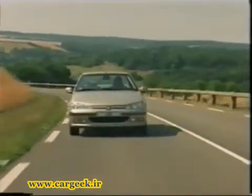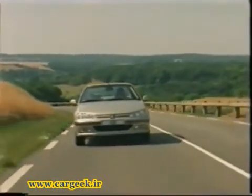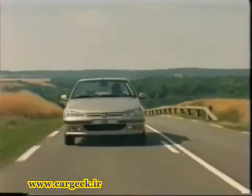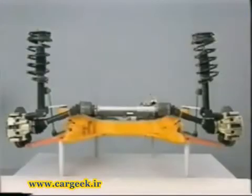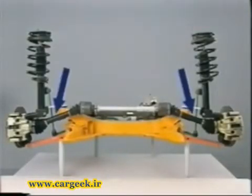In all current Peugeot vehicles, motion is transmitted to the front wheels by means of two shafts of unequal length, each comprising a constant velocity joint at each end. A short shaft on the left, a long shaft on the right, usually supported in an intermediate bearing.